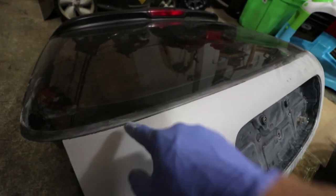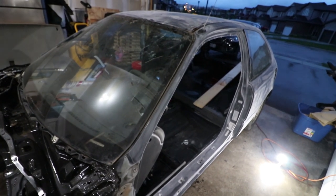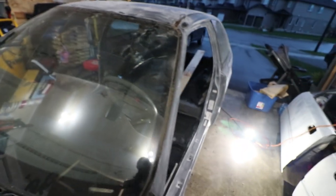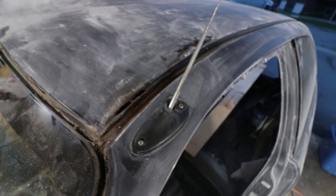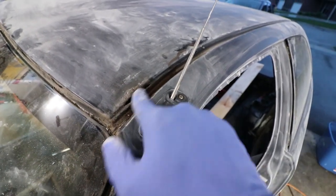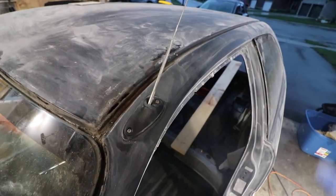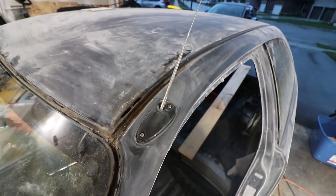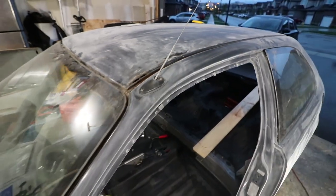You can see right here the previous person who painted the car taped the windshield, and that paint has peeled away over time. I have no choice but to buy a new windshield — you obviously can't pass a safety inspection with a crack this long on either side. Moving on, this section also has to be repaired — it's where water pooled and caused rust damage. I'm thinking I'll clean it out, use a rust converter, then apply epoxy primer over it and do bodywork on top to stop the corrosion from continuing.